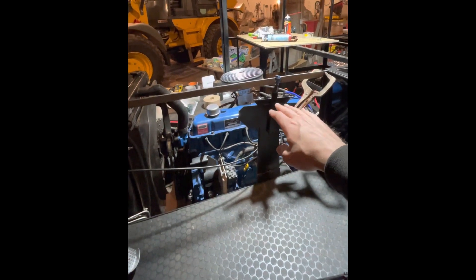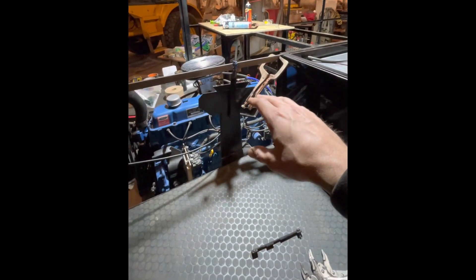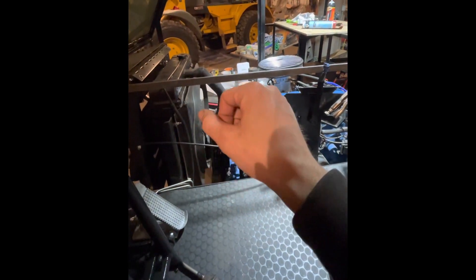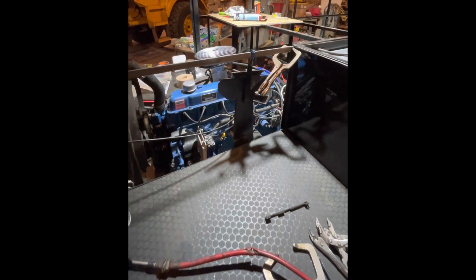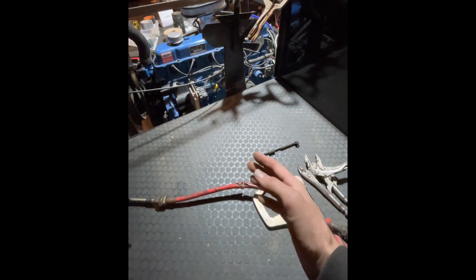The other reason is the doghouse is now about four inches taller, which gives our engine a little more breathing room and more space to work. With that, we're going to need to bring the shifter up and forward — as far forward as possible so it's convenient for shifting but out of the road so nobody accidentally knocks it into the wrong gear. The old cable needed replacing anyway, so we might as well move the shifter to a convenient location.